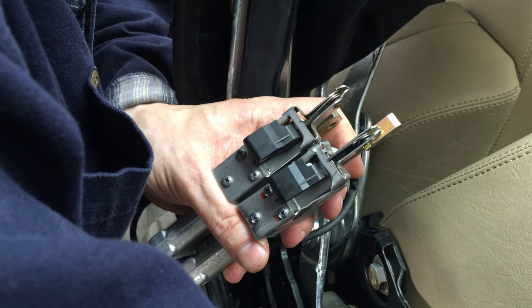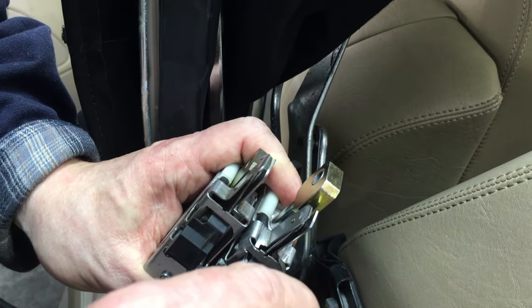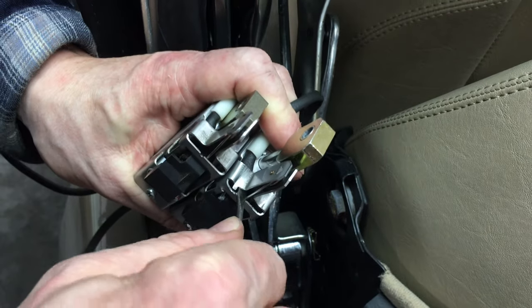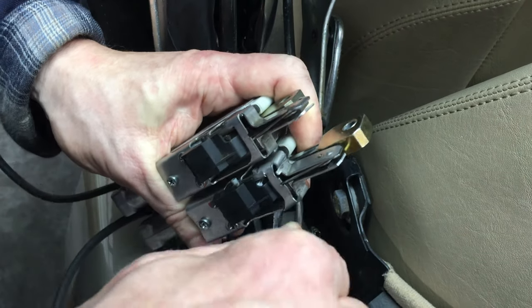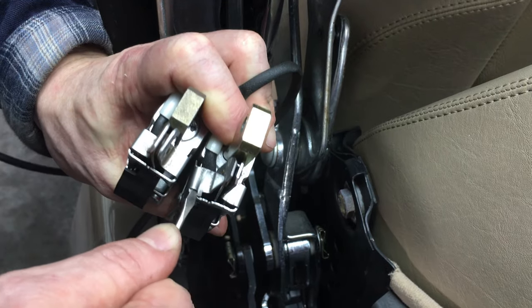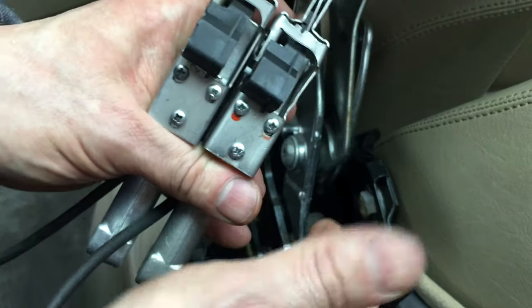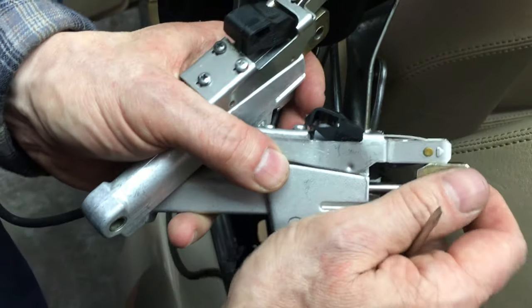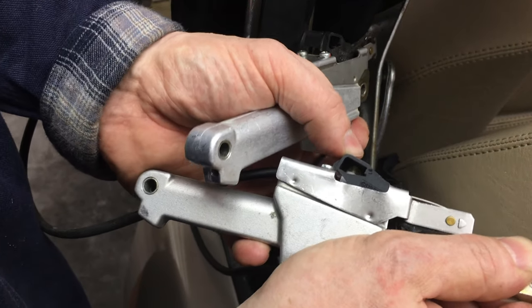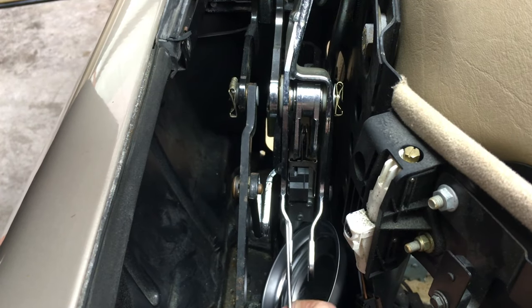To fix this, undo the original cause: where the frame originally pushed down onto the switch assembly, stick in a small flat screwdriver and take small steps on each side, moving a little bit at a time. There's a tab in the way to work around. The switch assembly may be straightened out enough to work — but if it's not quite triggering, you'd have to push a little harder. The safest way to avoid crushing the micro switch assembly is to remove it before removing the cylinder.